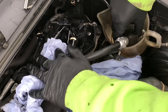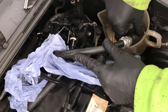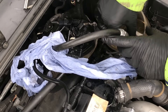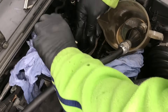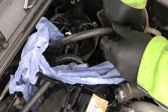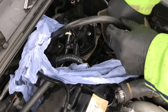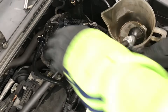Just keep topping it up and filling the filter housing — eventually it will come out of that second hole. We're getting there now. As soon as it comes out, reconnect the hoses so no air gets back in. Just pump it up — it takes quite a bit to fill. There it goes, it's starting to come out, so reconnect. Push the little white tab on top of the filter housing and that's connected back up again.